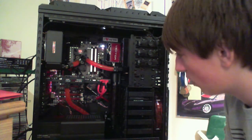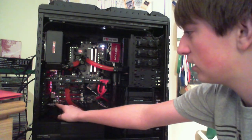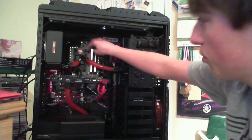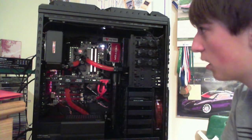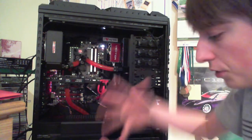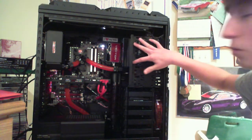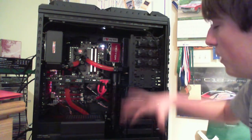But anyway, moving on down, I have all my USB connected. I do have my NZXT sleeved cable strip. This is 1 meter of the red LEDs, and they actually do glow pretty nicely. They don't block out the Corsair Dominator Platinums, so that way you can see those. I believe I forgot to mention this, but this is an AlphaCool UT60. It's a 120mm, 60mm thick radiator, and over here I have mounted in the drive base via Mountain Mods a 120mm triple bay fan converter.